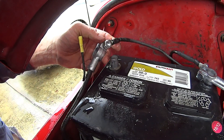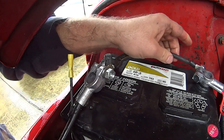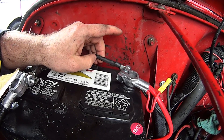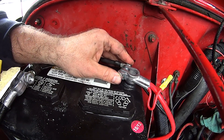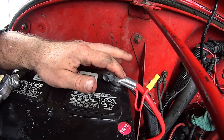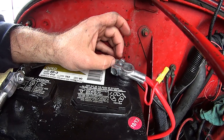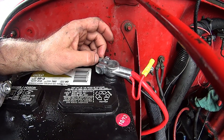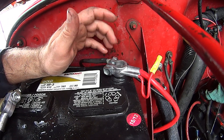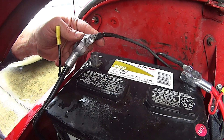Got this right here done. This makes the ground that runs from the fuse block. Don't be stacking too many wires on these terminals - you can do it but if you're stacking wire after wire after wire you need a different set of cables. They've got military-grade cable that's actually made to stack extra wires onto it, but honestly you're better off getting a power junction block and building off that if you're going to have extra accessories. Anyway, we're all soldered up and heat-shrunk. I'm going to bolt these babies down and tighten them up.